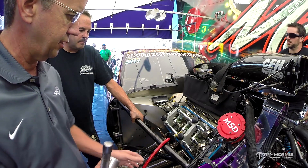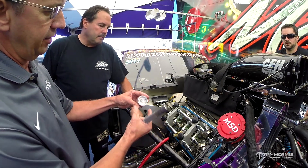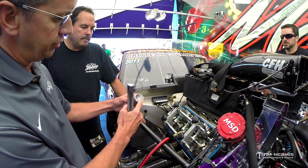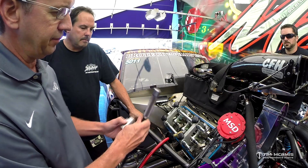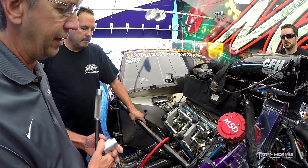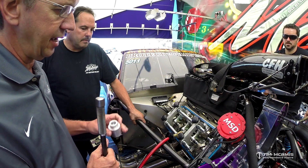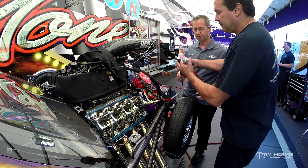What we've done is put a little air in the cylinder to hold the valve up tight. This cup is going to slip over the retainer — there's a little recess in here for the valve stem hole — and then this drive bar is going to go in here, and we're going to tap this with a hammer. It works best to use a dead blow ball-peen hammer to give it a sharp smack to bust that seal loose around the retainer lock. I'm going to hand this to Bill and he's going to show you how it works.